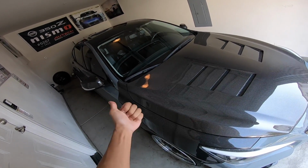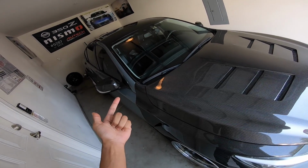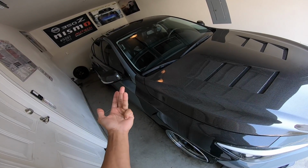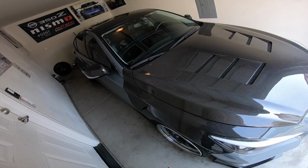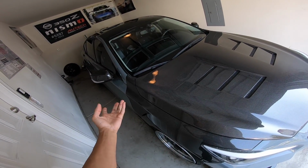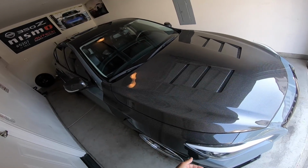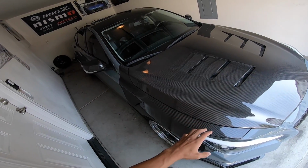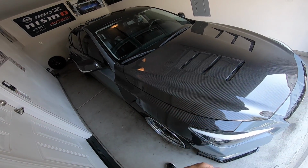I have a ported manifold intake. We're doing American Heritage ported heads, studs, all that small stuff. Doing a fuel pump, injectors, going to E85. Cam, we're doing a stage 3.5 or stage 4 custom BTR cam. I have long tubes for it. Basically, when it comes out, it's going to be full bolt-ons. There's nothing else I could do to that car besides build the engine for high compression or boost it. So it's gonna have everything.